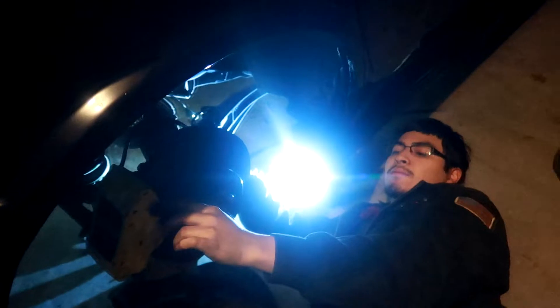See how it's connected to that caliper? That line also connects to this line. Once it's all connected, you open up the bleeder, let it bleed from here, hold it, let it come out, close it, pump the brake a bit more, open it, let it bleed out until you don't see any bubbles anymore. The stock caliper is still connected on this one — this line goes to the new caliper so we're just swapping that over.